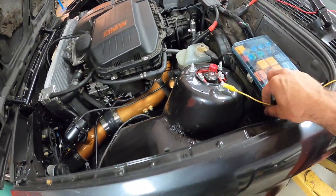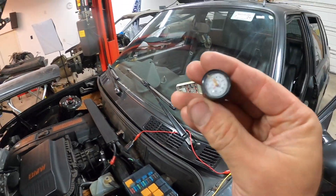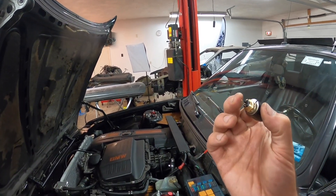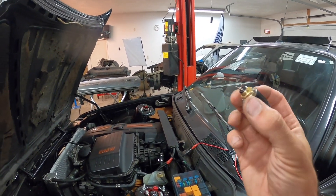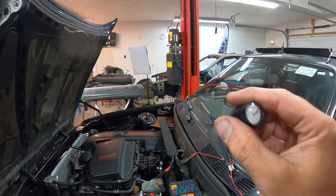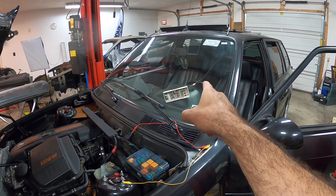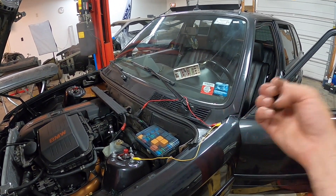This basically goes into the C101, and this is ground. What we have here is a potentiometer — a potentiometer essentially has three wires: one goes to ground, one goes to power, and the other one has your variable resistance output. For the purposes of this experiment, we are going to use two of those three wires and vary the resistance so that we can identify exactly what hash marks that corresponds to. So we need to turn the car on, hook this up, and start playing with it. Key on!